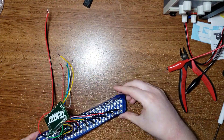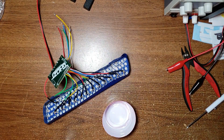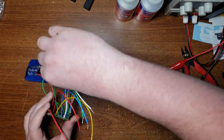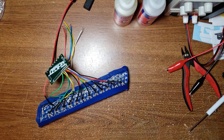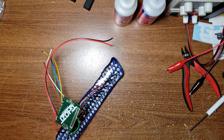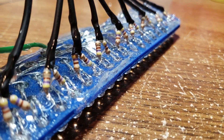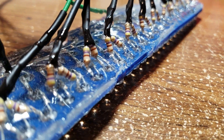Next thing I did here is wrap the outside with just some regular old painter's tape to kind of give me an edge there to fill in with epoxy, which is what you see me doing right now. Pouring in the two parts of epoxy and mixing them together, then pouring them off the back of the panel and letting that tape act as the sides to the actual module. There it is done with the epoxy dried on there.